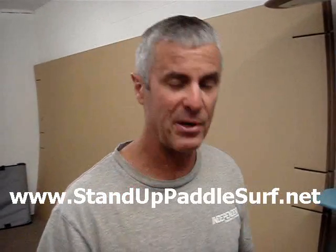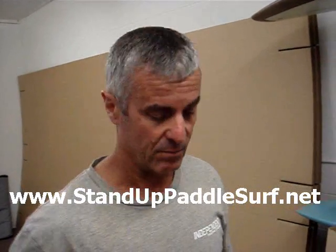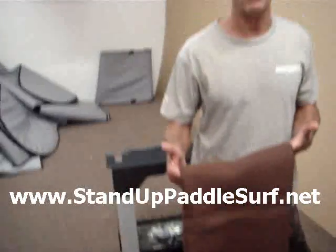Does it make it stronger? Hemp is strong, right? Incredibly strong. Hemp and epoxy are so strong you can't believe it. Would you use that instead of glass? Well, we replaced some of the glass. We put glass over it, but I put a lot less on it because this stuff is thick and it got heavy. But I just put one layer of hemp and one layer of glass over the top of that thing, and it's bulletproof.